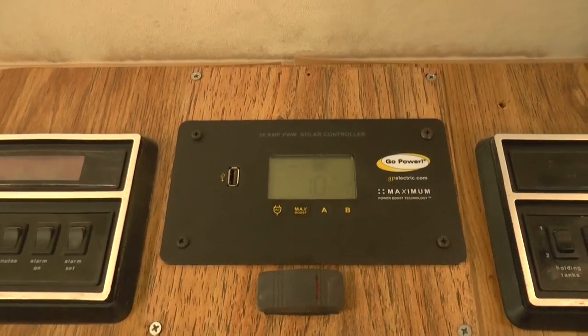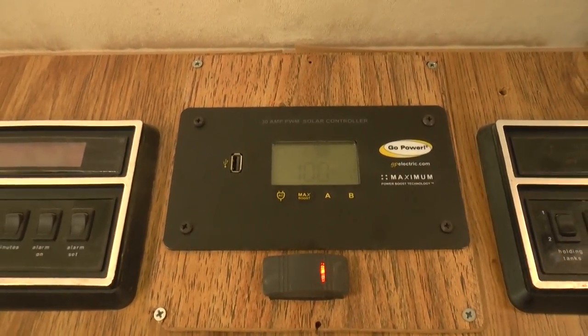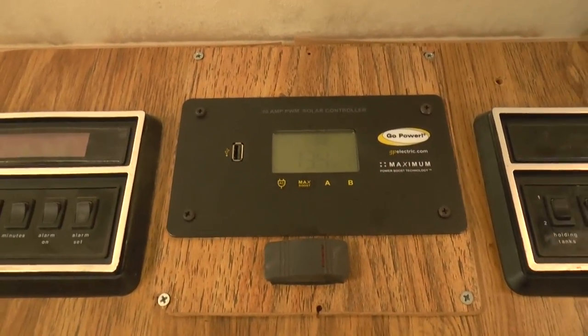We're ready to test it — we're going to hit the on button. I can tell the generator is running. Now we're going to turn it off. Success! Now we have a remote start/stop switch in the motorhome. I hope that points you in the right direction. If you have a different generator you'll need to look up the wiring schematics to figure out which wire goes where. I also had to go to Radio Shack to get the right pin-to-female connectors so they're nice and stable. Please like, share, subscribe, and leave a comment. My name is Jim with Full Moon Adventure Club — happy camping and thanks for watching.